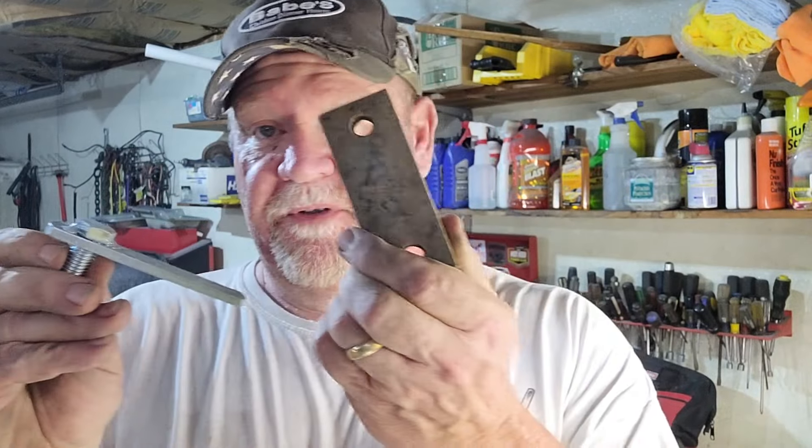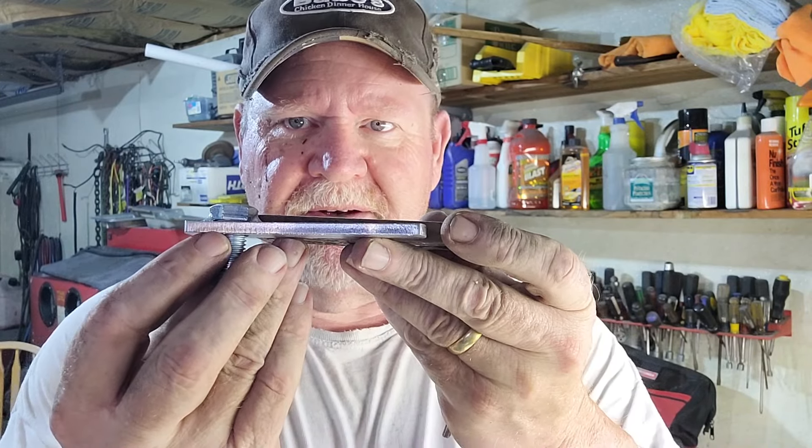This is the replacement piece for the original backing bar. As you can see, there's a lot of strength difference — like double. So basically, I'm going to use the original piece with the original bolts for the L-brackets through the frame, because these are stronger and bigger than the new ones. They line up, so I'm going to use the really beefier original parts to mount the L-brackets for the bull bar.